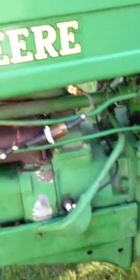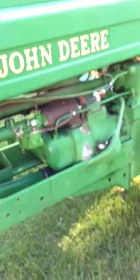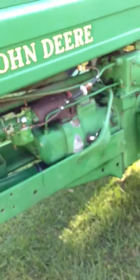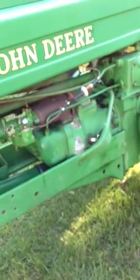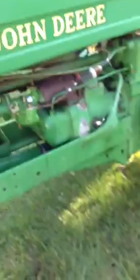It's running, although my float isn't working right. It's actually flooding the whole carburetor if I let it sit with the fuel going into it. So I'm going to have to drop the bowl and find out what's wrong with that needle since it's brand new.